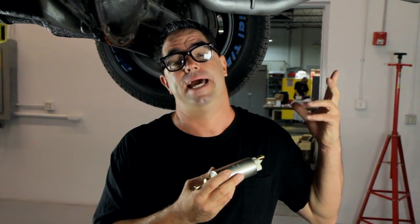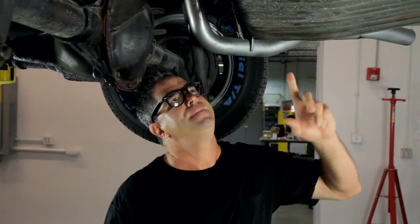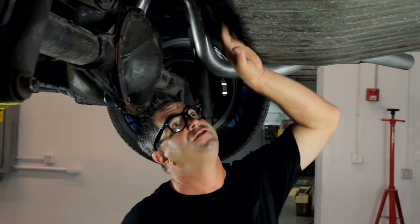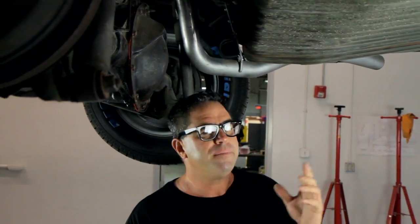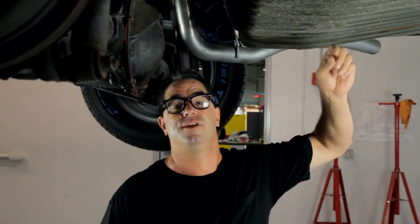Mounting the fuel pump is pretty straightforward, but does require a little bit of planning. In our case, we're going to be using the stock in-tank pickup unit. Keep in mind, we have 300 horsepower, so the 5/16 diameter is fine. If you have a lot of power, like 500 or more, you might want to think about resizing the pickup to 3/8 or larger to make sure you have adequate supply.